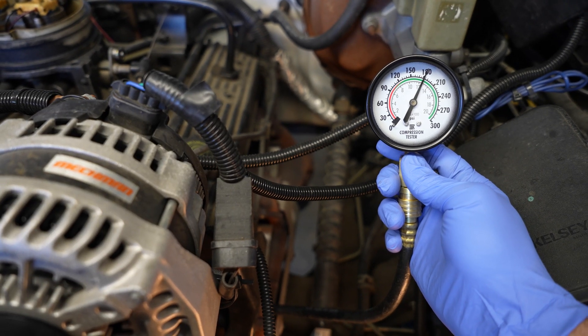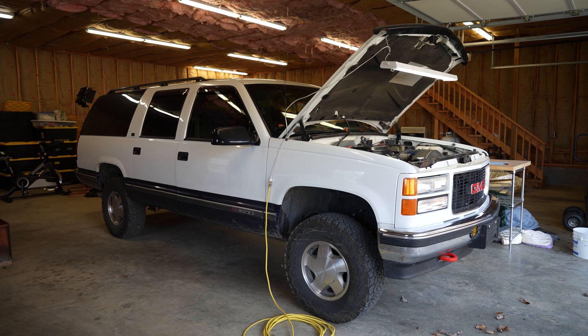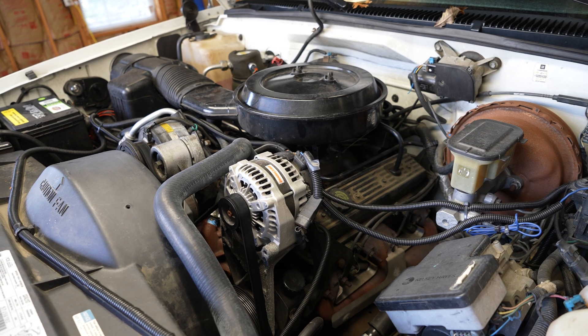As you can see, this time we're sitting just over 180 PSI. Today we're going to be doing a compression test on this 1995 GMC Suburban. It's got the 5.7 liter throttle body injected 350 in it. Surprisingly, this thing only has about 86,000 original miles on it. That being said, it is from 1995 and this is the original engine, so I'm curious about the actual health of this engine. I figured, why not do it right here on the channel?